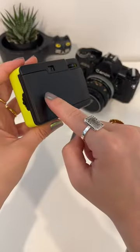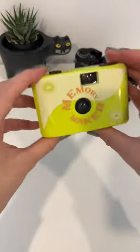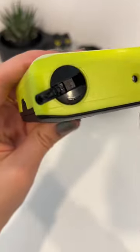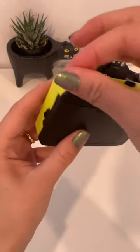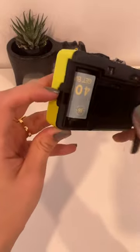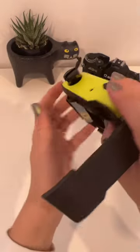Never open the body of the camera until you're finished with the roll. Once you are finished with the roll, here's how to open the camera to get your film. Press this little button on the bottom and start winding the film clockwise. Keep winding until the tension releases — it should feel easier to wind when it does. Open the body of the camera from this little lever, pull the latch up, and then you're ready to go ahead and take out your film.